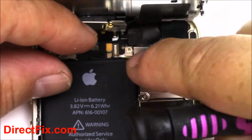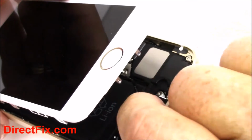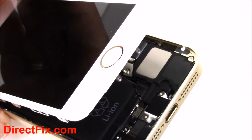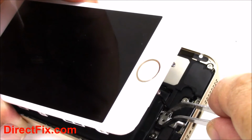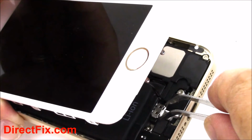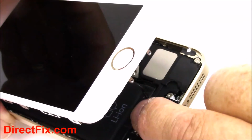With all 4 screws installed, we're now going to take the connector ribbon cable that goes from the screen to the main board and connect it. Don't forget about the shield and the clip, which is the same thing, that will hold the connector and of the ribbon cable in place from the screen.